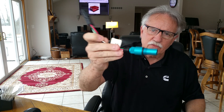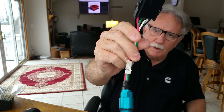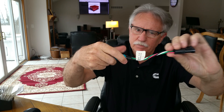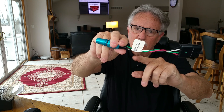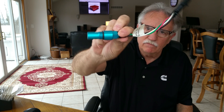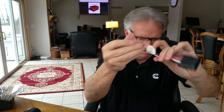Here's a cam sensor — I'll cover it more in other videos. It's got four wires, two pairs, and there's a backup pair. I always like to twist them a little bit because a lot of this signal wiring is like typical PC networking — twisting causes less crosstalk, especially if you've got an alternator with a diode starting to go bad. You need an 11/16 wrench for the slot to put the socket on it, and it just twists around.